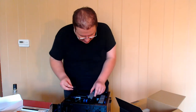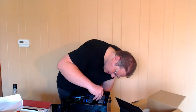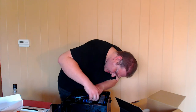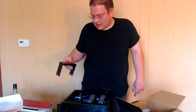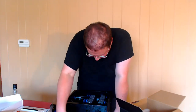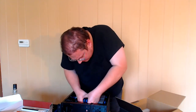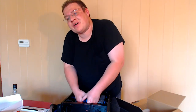Okay. So I'm gonna sit them right on top of the heatsink. Go 2 fins down. Put the flat boy underneath and the rounded end on top. Okay, and we'll save these for the last, once we get the major fan in. Okay, now we have one connector we gotta make sure is connected in here, because it's in a very awkward, very difficult to get to place, which will require some finger jangling.